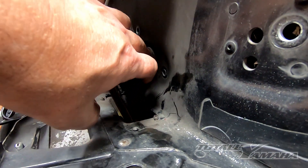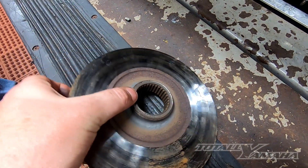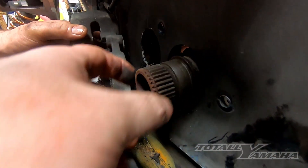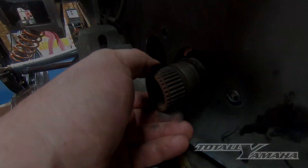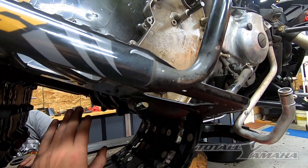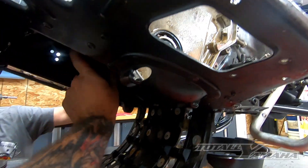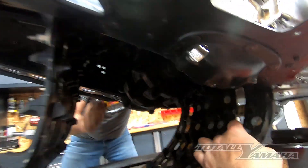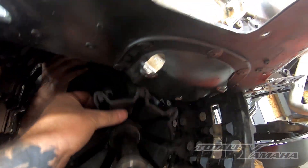What we're going to have to do is probably have that spray metaled, depending on how much tolerance is taken off. You can see once the disc comes out there's a groove worn in it — that's a telltale sign that the inner race was spinning on the shaft. You can see it's eating the shaft because of the poor tolerance between the inner bearing race and the shaft. As you push the shaft over to the clutch side, you're going to have to loop the track above, then fight it a little bit to get it off the lugs. The shaft has to go all the way to the clutch side and it'll fall right out.